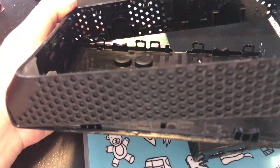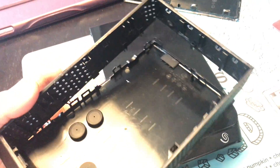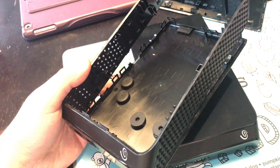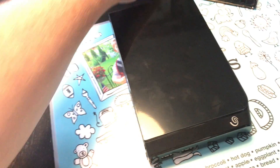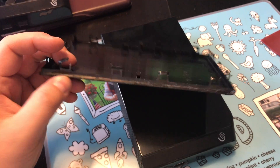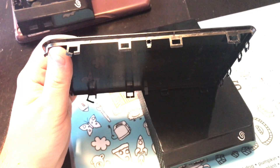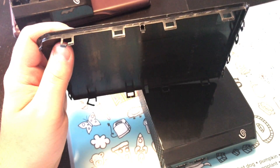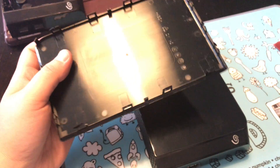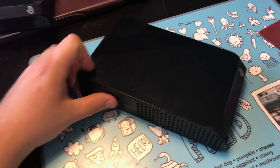As you can see over here there are tabs — some have snapped, you can't be perfect. I did the top first because I originally thought the top might be the main part, but it's actually the bottom. These things snap but it's fine. I'm mainly using these as internal drives. With USB 3 and 3.1 as an external I was only getting 20-30 megabytes a second writing, but when I shoved one in internally I got 100 to 150 megabytes a second. So it is possible to do it.